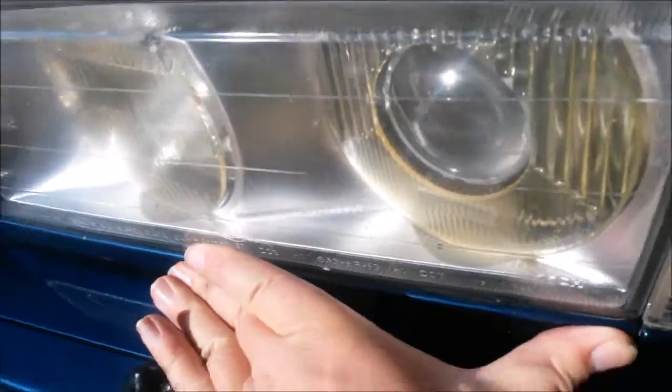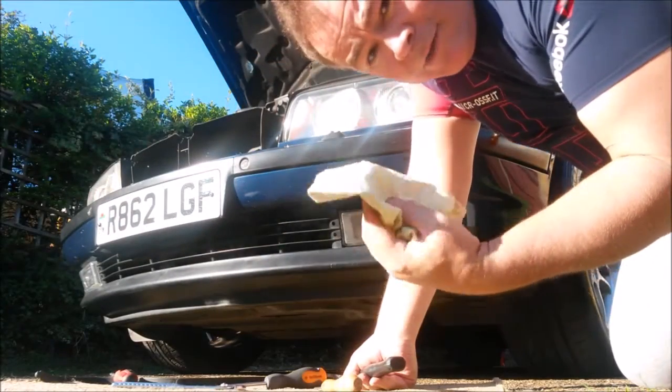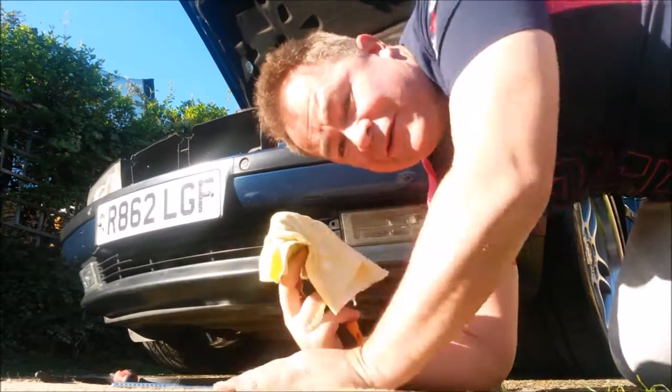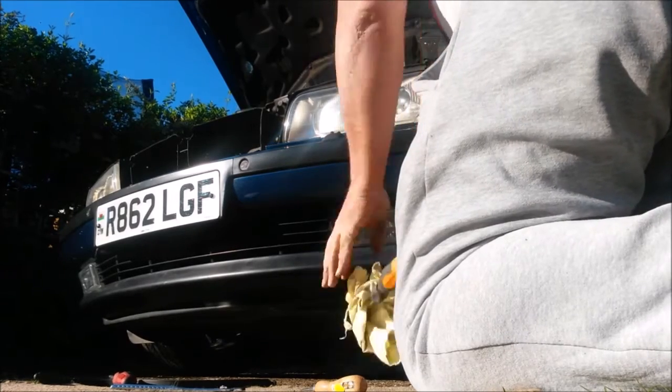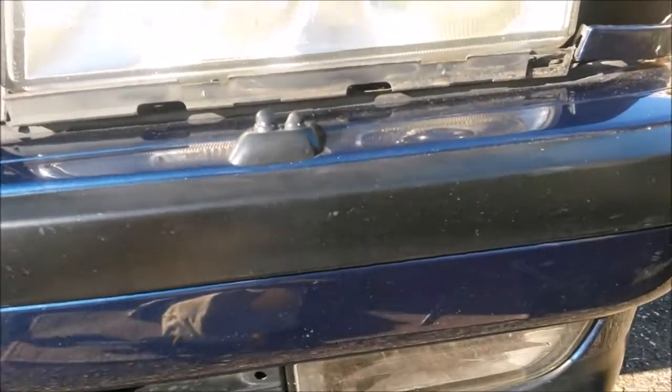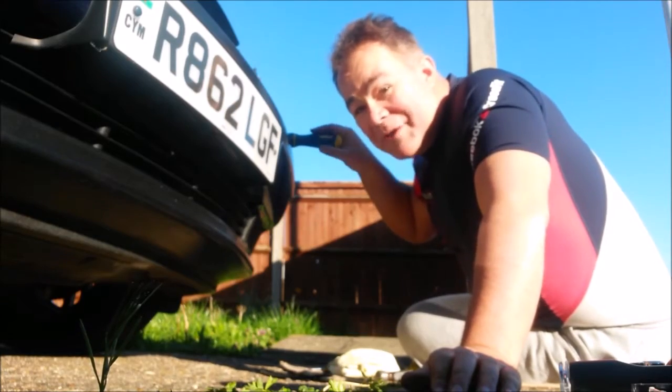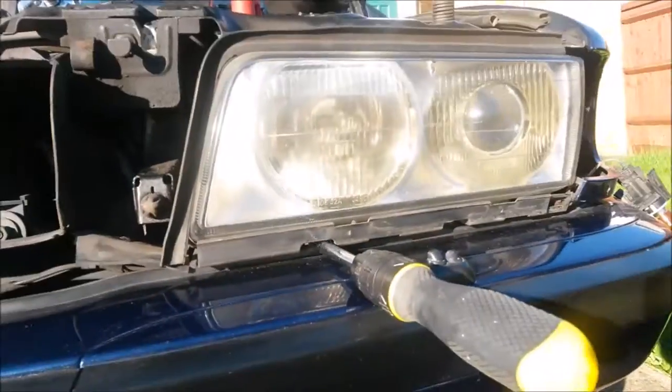Push the indicator light forwards and out she comes. Unclip the wire, and in here just feel the end of a spring clip — push and release the lower eyelid. You have to slide that towards the center of the vehicle. My lower eyelid is stuck on really hard, so I'm going to wrap a cloth thickly around a blade screwdriver. There are two notches here and through there there is a tiny little star screw about three inches in — I really hope this doesn't drop in there.